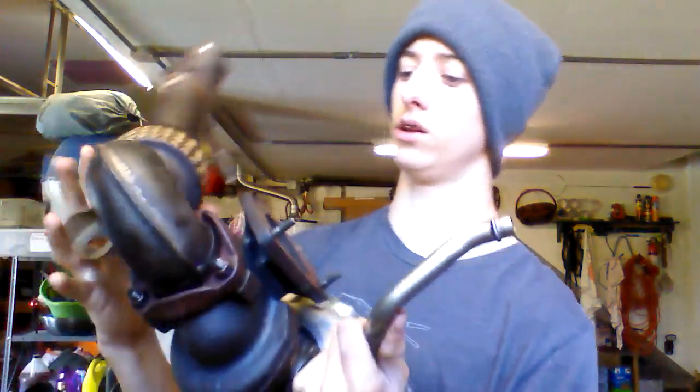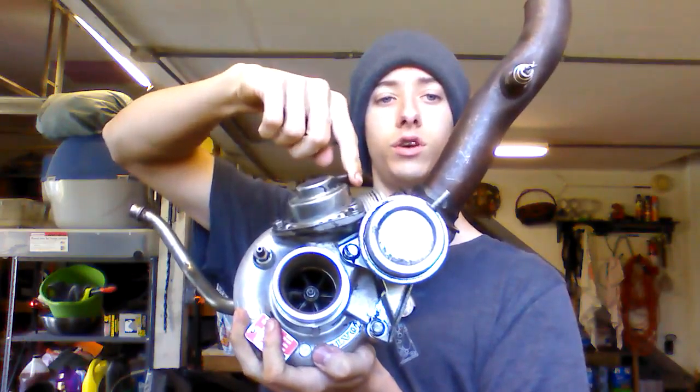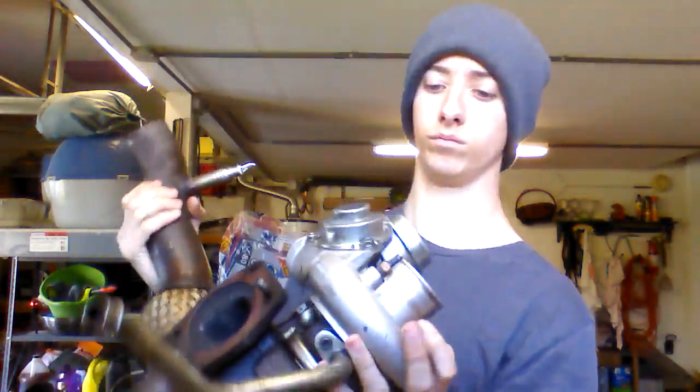Yeah, so if you guys ever watch Mighty Car Mods, I'm just going to be doing what they did. Pretty much taking a hose, hooking it straight up to here, just wastegate pressure. Actually, the turbo they used on their MX-5 actually was a TD04, not necessarily from a Volvo, but same setup.